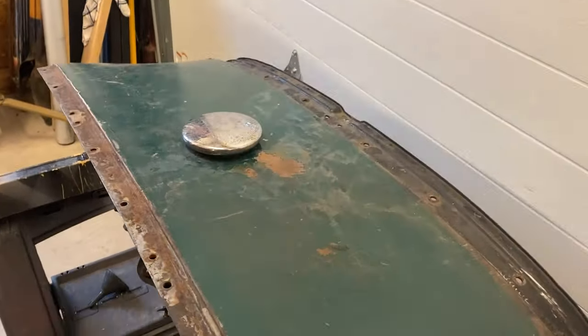Once we felt confident that we had gotten the sealer applied to the entire interior of the gas tank, we loosened the plug on the petcock hole and started to drain out the excess. Because the Model A has a low spot where the petcock hole is located, it's important to fully drain out as much of the sealant as possible so that it doesn't puddle up at the hole. We're almost a half a can coming out. Wow.